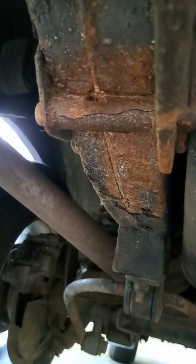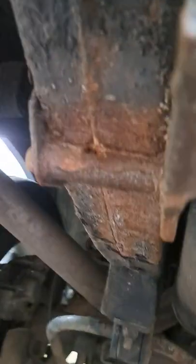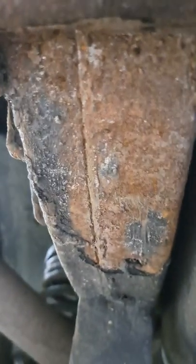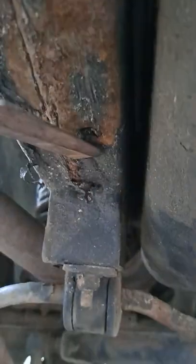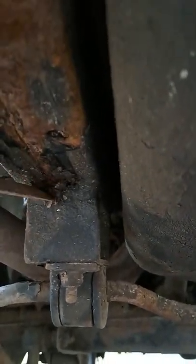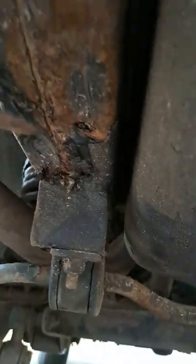This is a wee video about coating your chassis. Lots of people coat the chassis in this black stuff and I don't like it. The reason why I don't like it is after a while it starts to break down and the water sits between the black stuff and the chassis. These little pockets will actually come off!